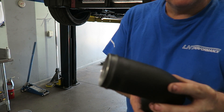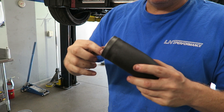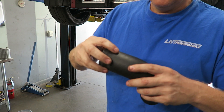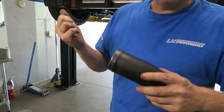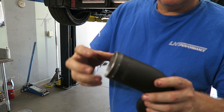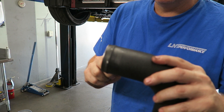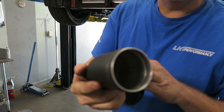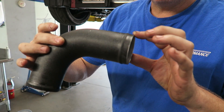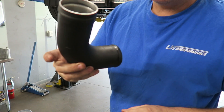It seems like we've got to fix all of these pipes. With turbos, they develop an oily residue in here and it will find its way into the silicone connector. When this blows off, usually it's behind the bumper and it's never the easy one to fix. To prevent this you put a bead on the pipe — and you can see we've cleaned up the pipe where it had the raggedy edge. We're having to do this with all the pipe and this is just terrible — we see it a lot.